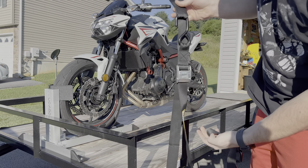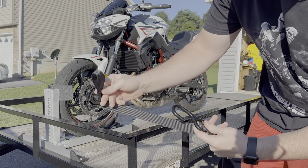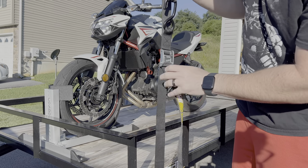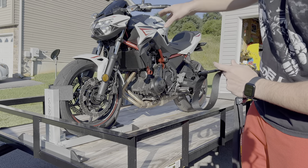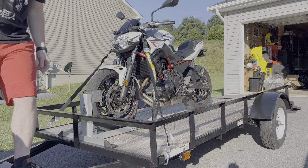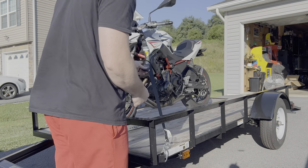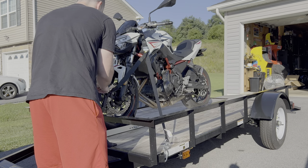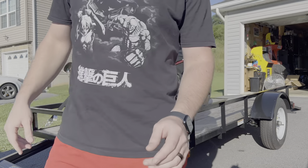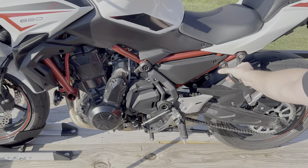Here I've got these handlebar straps — this is Pro Taper brand. It's got a hook that goes around the handlebars and hooks to itself, so you're not damaging anything. This style just pulls — it's not a ratchet. You don't really have to over-tighten, just a little bit, then hook it to the trailer down here. Once both are on, hop up and press the front suspension just a little bit, then give it a little more pull. They also come with velcro to keep the excess strap from flapping in the wind. Two straps up front should be good — you can check by giving the bike a shake.